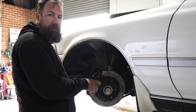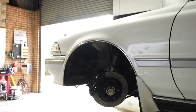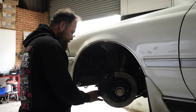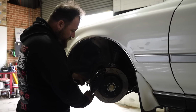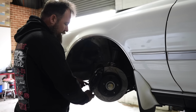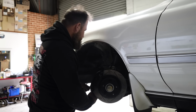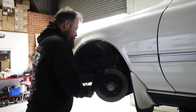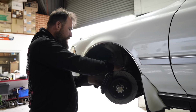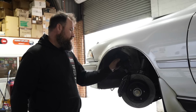And I think people even jumped in the comments when we first redid the brakes in the stock kind of setup, going, oh, why didn't you do the R33 brake upgrade? At the time, it was because we were running 15-inch wheels and there was no way we were going to fit them. Interestingly, I think we may actually go down the same path with the Cresta of using the R33 brakes, because the wheels that are on it just don't really cut it. Interesting. So I think the actual answer is probably the exact same conversion, then convert to MX83 spindles and lower steering arms.